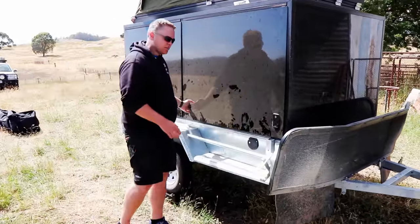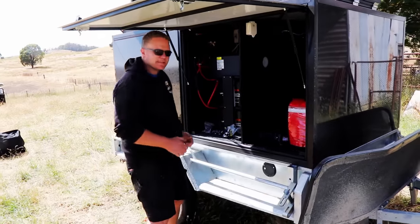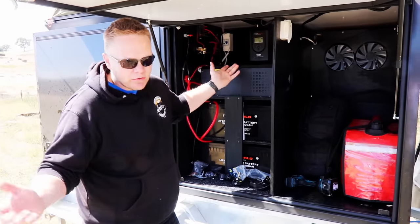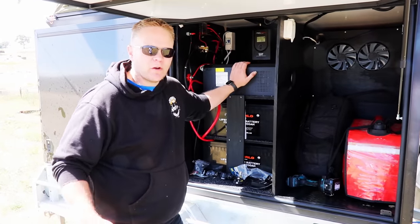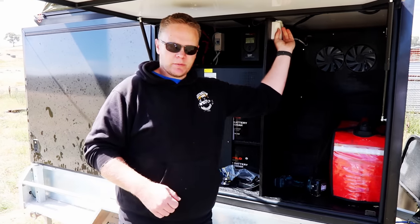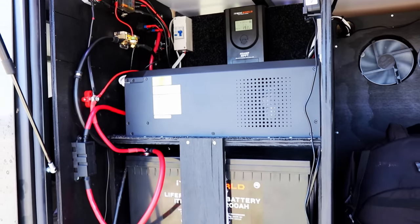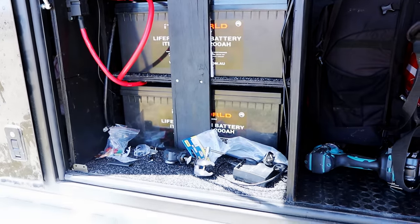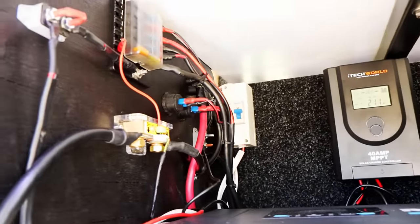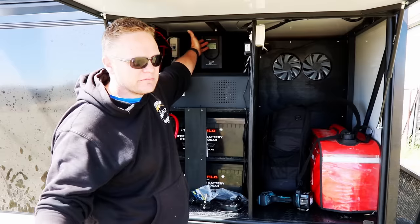This is the main brains side of the camper, so we'll start opening some stuff up. Inside, this is all the cool stuff — we've got a Renogy 3000W inverter charger, essentially a 3000W inverter and also a 75A 240V charger, so it'll put 75A into your 12V batteries when you plug into mains 240V shore power. I have a solar controller which runs to a 330W 36V house solar panel. Yesterday on a good day we were putting in about 20A, which is more than enough.